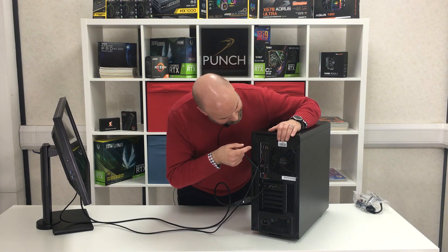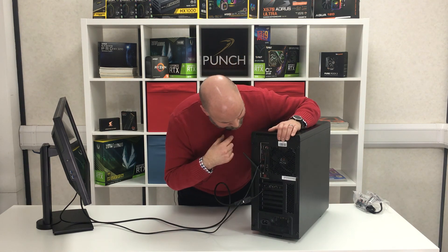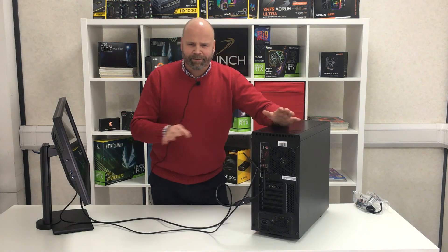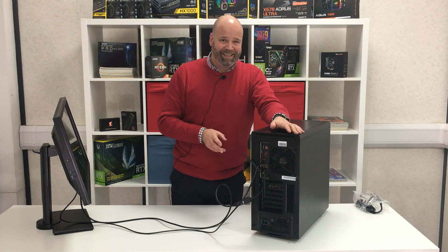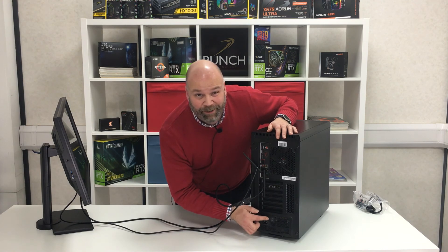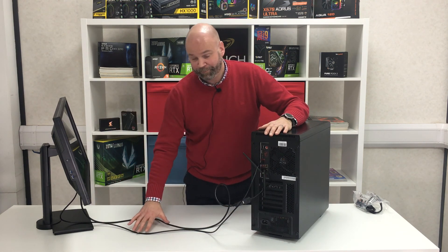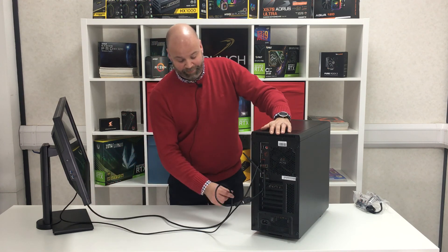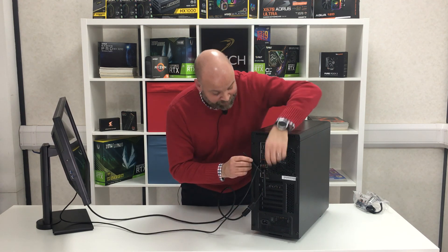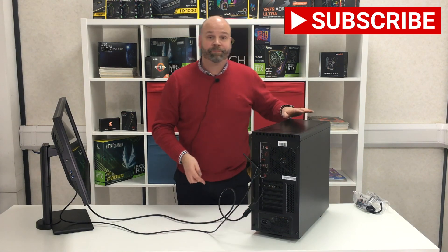If you're looking for your keyboard and mouse — if you've got an older keyboard and mouse, you still have the PS2 connection, otherwise use your USB ports. This port here is your ethernet connection if you want a network cable. Once you've got everything cabled up and you go to switch it on and it doesn't power up — did you switch on the power supply? That one catches out quite a few people as well. But if you've got everything cabled up with only one display cable linked to the graphics card, your WiFi antennas on, keyboard and mouse in, and your power supply switched on — you should be ready to go.